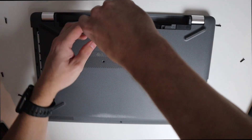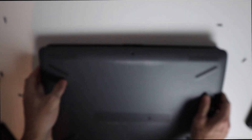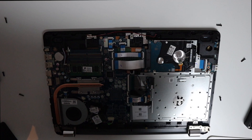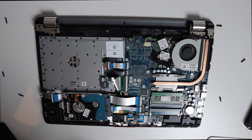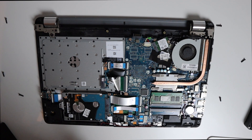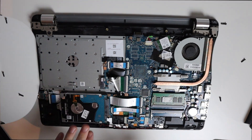There are also screws on the battery compartment. After unclipping all the clips — it's got quite a few — we're inside the computer. Right here we have the hard drive, which is what we're going to replace. You can also see where the CD drive sits, the fan, and the RAM slots, so you could upgrade RAM from here as well. But right now we're just doing the drive.